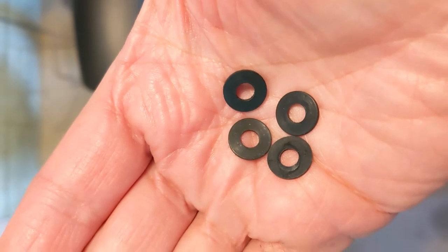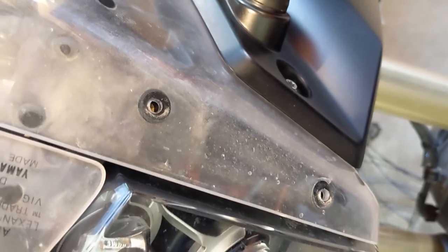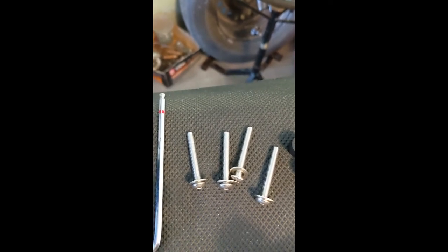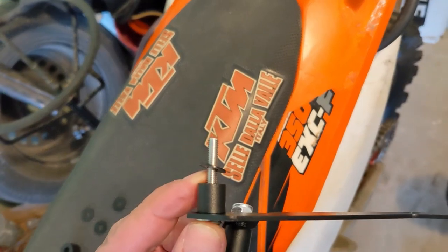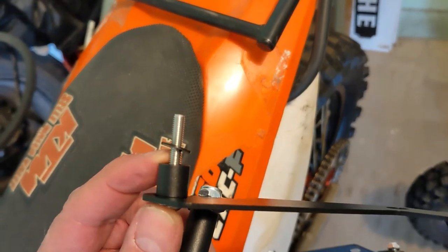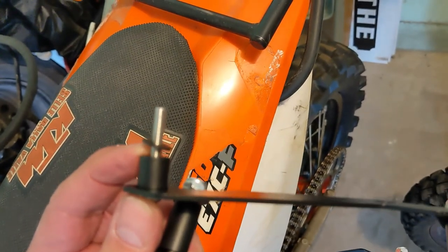So these are the four rubber washers that came out. You will not need the original bolts, so you can discard or save those. Now you take the four smaller diameter bolts and slide a flat metal washer over each one — these will be used to attach the grille to the bike. Then you take the bolt with the metal washer and slide it through the top hole in the bracket, then slide the shorter spacer and then the rubber washer that you took off the bike over the bolt. That's going to be used to secure it to the bike.